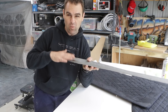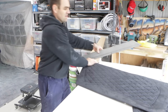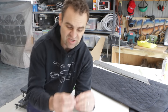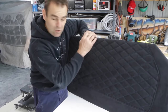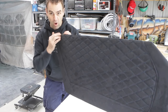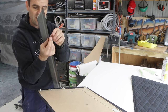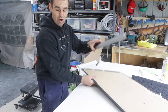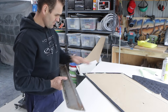The thing I'm going to have to do is work out a way to attach this because obviously I have to cover this in vinyl and sit it in behind this door trim. My plan is similar to what I used on some of the bits on my 911 - I got these little paper clip things that spread open. I'm going to peel back the top edge, drill the corresponding holes and poke these through from the face so they'll go through from the front behind the cloth, poking out the back, then stick the top edge over it and spread them out, clip it down and the two parts will be joined together. So first things first, let's mark out where this goes on the door trim and drill some holes.